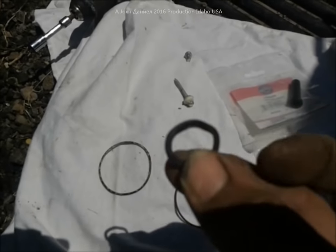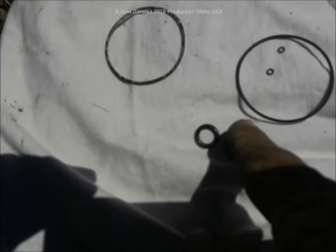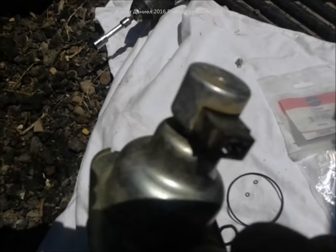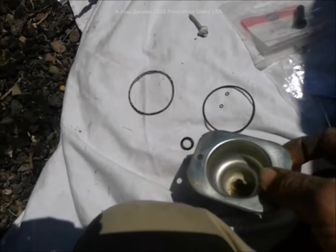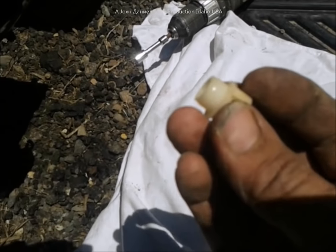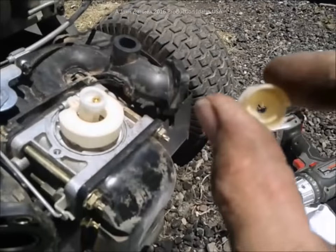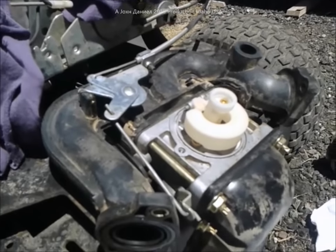Look at that — look at the difference. This is that O-ring. That's years of gasoline going through it, almost 600 hours of use on this engine. You're going to remove your fuel bowl, which has the shutoff on it — it activates, pulls the plunger down, allows the fuel to flow. Whenever you're not powered, it springs back up and shuts the fuel off. However, if this plunger is allowing fuel to get sucked in around it instead of going through it like it's supposed to — through the hole there — that's where your problems are. She'll surge and hunt like she can't find her RPMs. That's your issue.